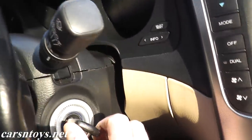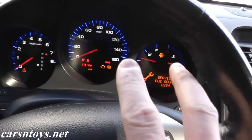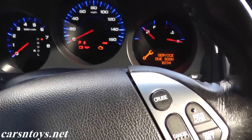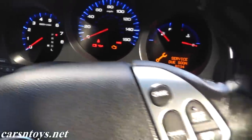Here's a quick video showing how you can program your key fob — in this case on an Acura TL. To do this you need the ignition key; turn it to the number two position, which is the on position, so all of the gauges light up. Once you turn the key, within one to four seconds, take the key fob and point it toward the wireless receiver.